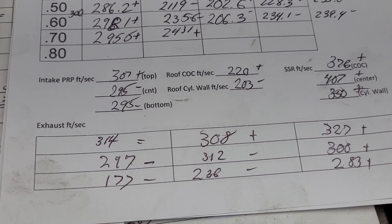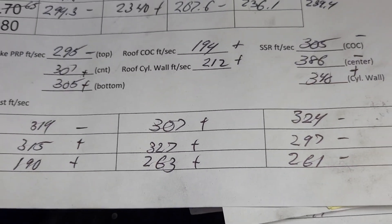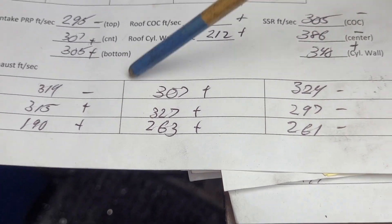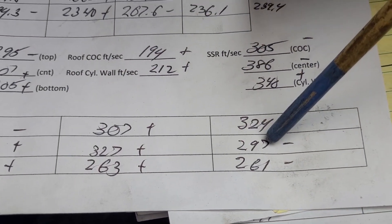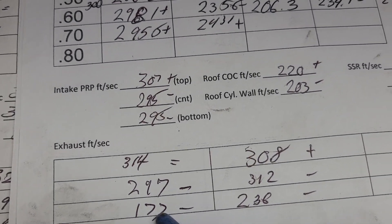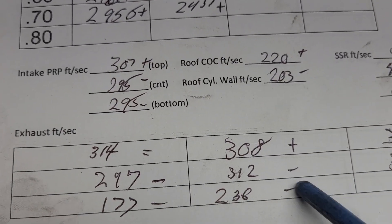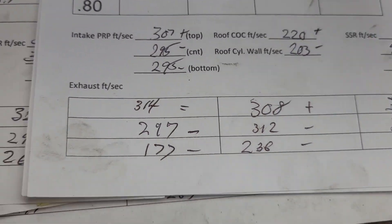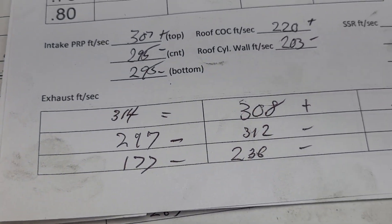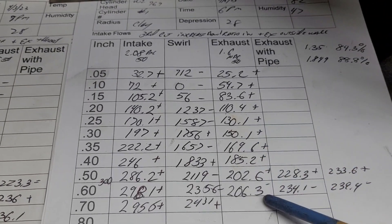The exhaust didn't look that great as far as my speeds - that was a step down from the 45 seat. But it really doesn't look bad; we're all 300 plus, and this one is almost 300 with a decent amount on the floor. One side was a little shy, and guess what - it got a little worse when I did more work to it: 314 is equal, a couple went down a touch, one went up. That wall I said I had to look at last time - it was all minuses, but what I did obviously worked because that wall did go up, and the whole curve for the exhaust port is a little bit better.